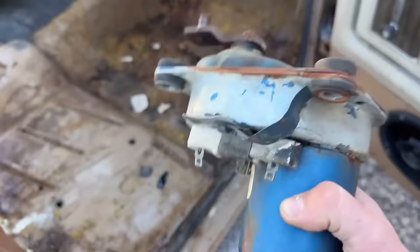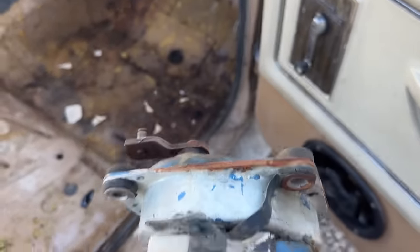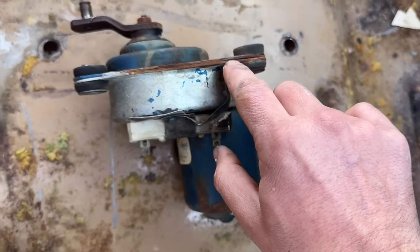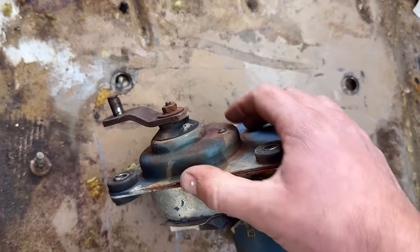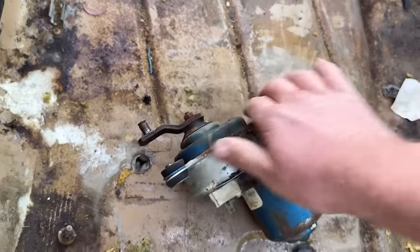And also we got this going on, and it's not really serviceable technically. Set this down. You can see the housing, and then see that seam right there. So this plate comes off, and our problem is in here, because the motor sits like this and the rain comes from the top, and this is where it gets.